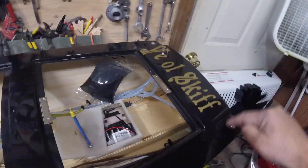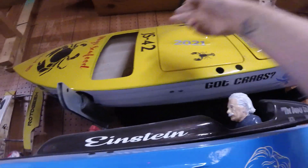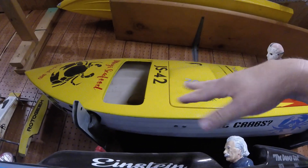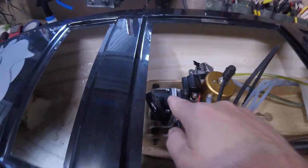Water outlets are here. The thing I really like about the Ricoh over the Insane Skiff — the Insane's that yellow one up there — is this cavity right here where the pull start is. On the Insane it's really hard to get to that pull start. I use pull starts on most of my boats except hydros and riggers. Once they're warmed up I use the pull start to keep running — I don't use the electric start every time, only when it's cold or I've flooded it with water. But look at the size of this cover — much easier access.